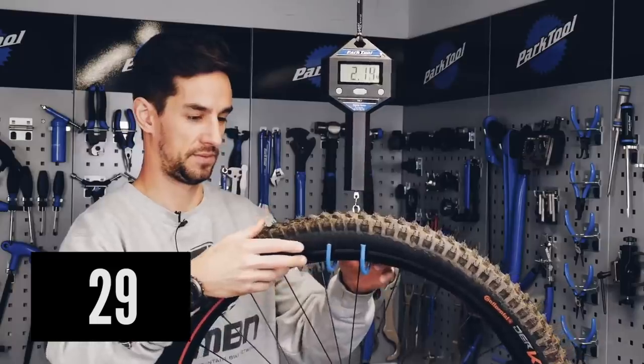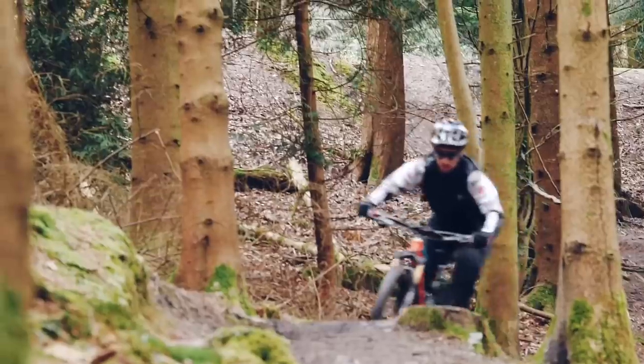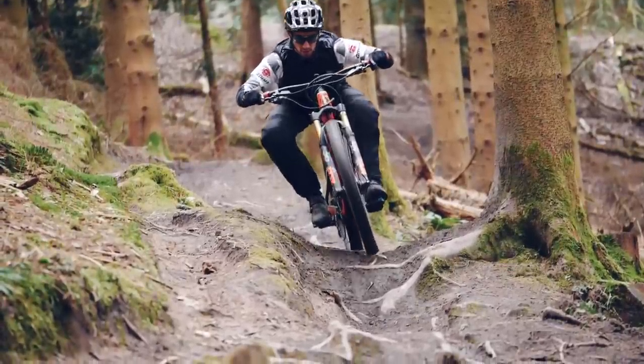There are a bunch of other factors to consider. Comparing 27.5-inch versus 29-inch: the smaller wheel is technically lighter for the same type of wheel, so it will accelerate faster. It also means it will decelerate faster — slow down faster — which is a good thing because you can change direction, accelerate and slow down quickly. The downside with the smaller wheel is it doesn't hold speed as much. However, because they accelerate faster, it's easier to top up on that speed. So if you're the sort of rider that likes to bob and weave and jump over stuff, smaller wheels may well be better for you.